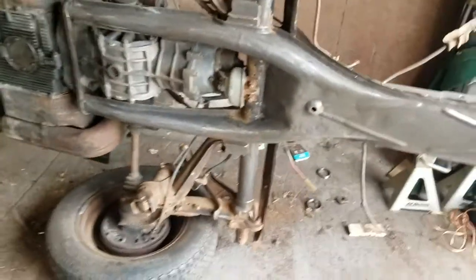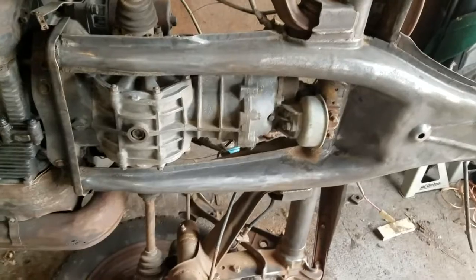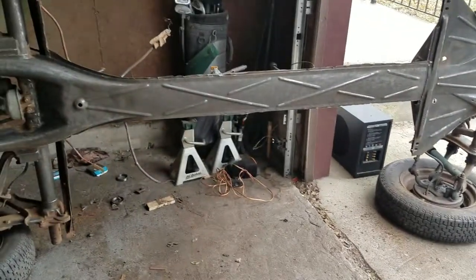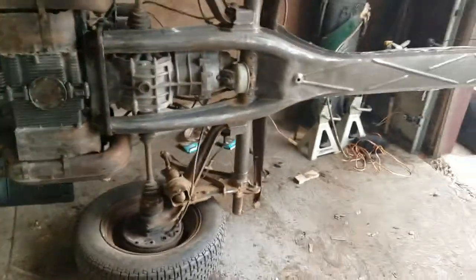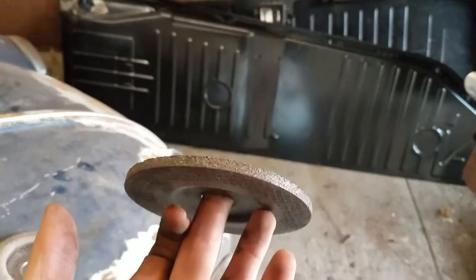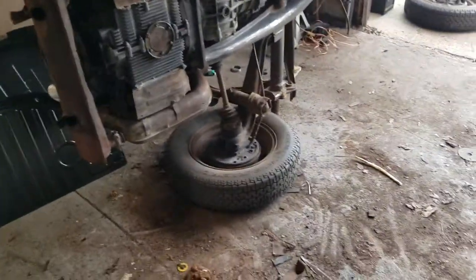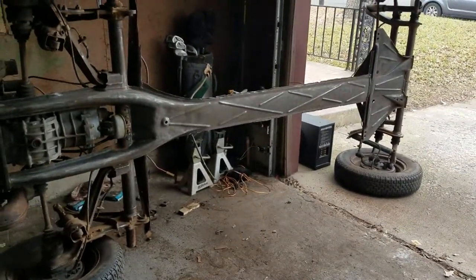That's where I got to today - I can't really get much further because of time and there are little spots I can't get into, and I don't have a paint sprayer so I'm not quite ready to start prepping for paint. At least I have all the loose rust off. Anything else is pretty stuck on there, so the phosphoric acid will get that. If not after the first treatment, I'll take either the grinding wheel or the flap disc to it and treat it again with the acid. It's moving along - haven't given up on it yet, don't plan to.